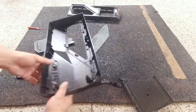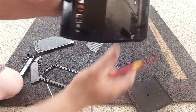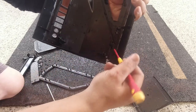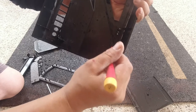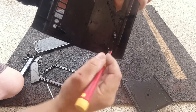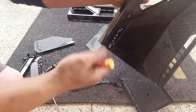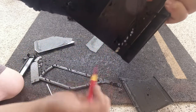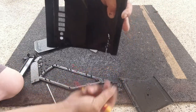We removed the buttons — they're clipped in. What you want to do is simply pry these out and they will slide out. Pry them towards the center and push it in like this and then it pops out. Do the same to this one — pry it towards the center and push it in, and it pops right out. Same goes for your little light here — let's push it through. As you can see they just used a dollop of glue and that's all that holds it in.